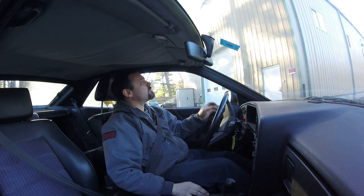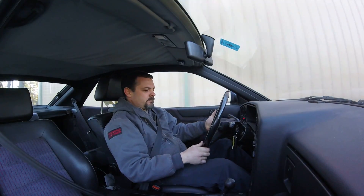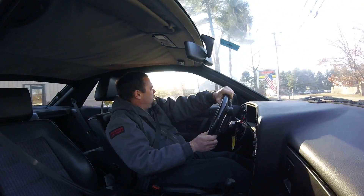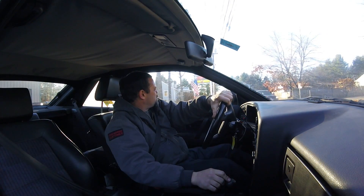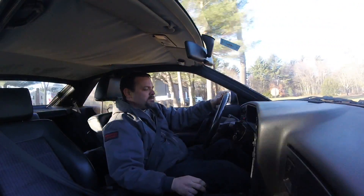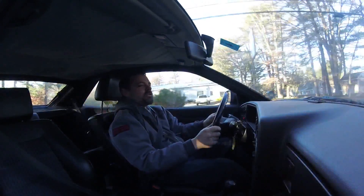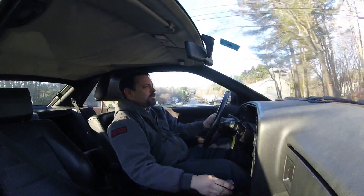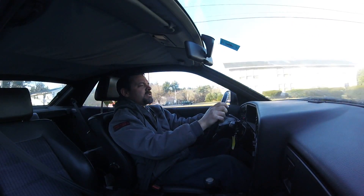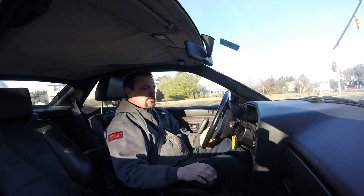Not really very free-revving. I'm going to keep the revs low because she's an old girl. The car weighs about 2,700 pounds, about 160 horsepower — so it's not going to be much faster than your average stock Honda Accord or something. Shifts a bit notchy. I don't know if that's just from age — I think these were a little loose back in the day. Kind of a complicated shift quadrant used on these transmissions. Lasts a long time, it just feels a little loose. Steering inputs are really quick. This has upgraded brakes with drilled rotors. I didn't feel like there's very much power assist — really rock hard pedal. It might just be an issue with this car.